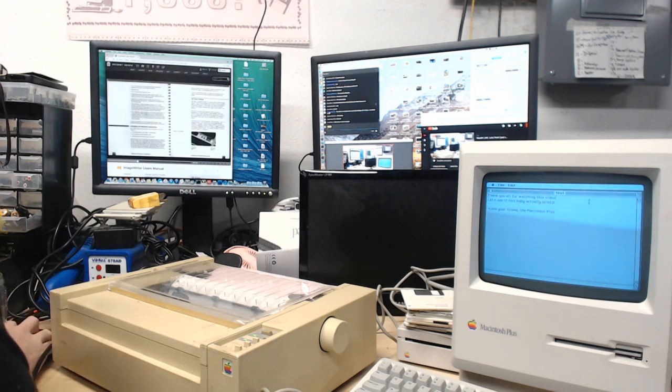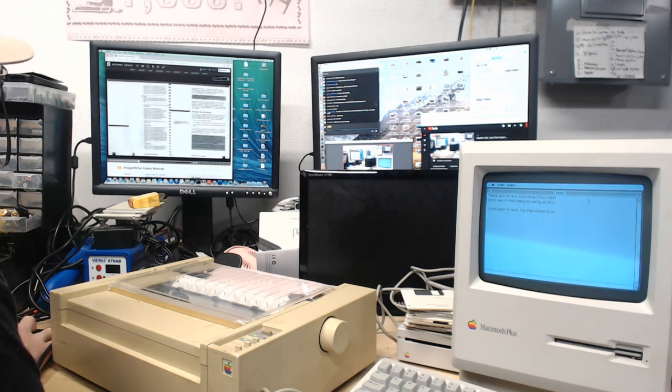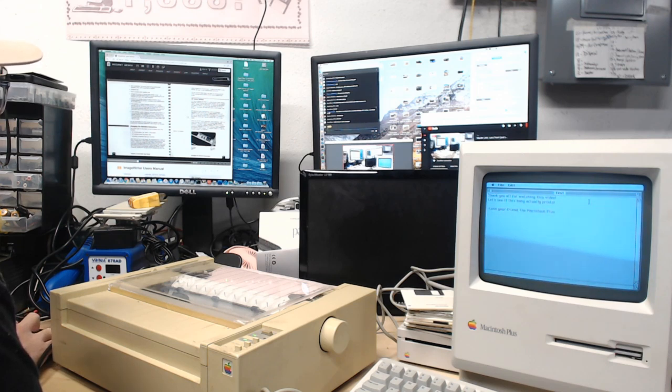Controlling your printer, changing the standard instructions, dip switches. Okay, does it tell me the default ones? The two dip switch assemblies: switch one is toward the back of the machine, 8 switches, 1 through 8. Switch assembly 2 is toward the front of the machine, 4 switches. Okay, what are the defaults?